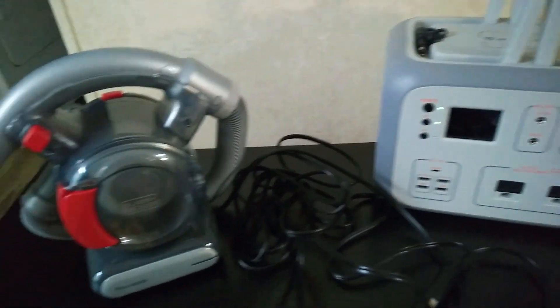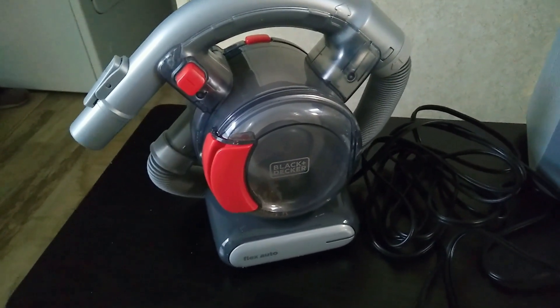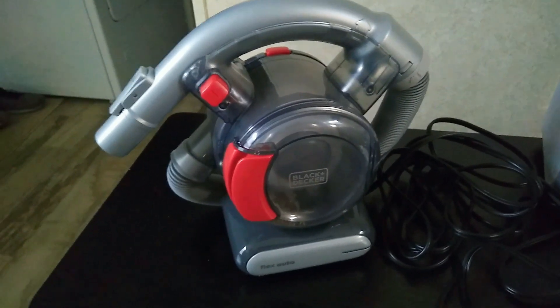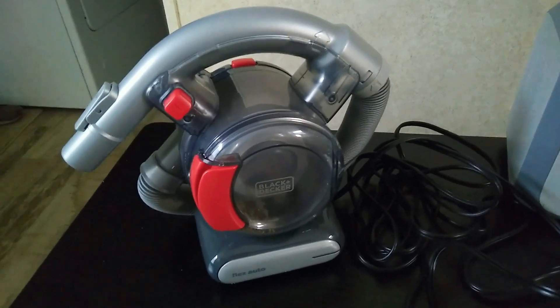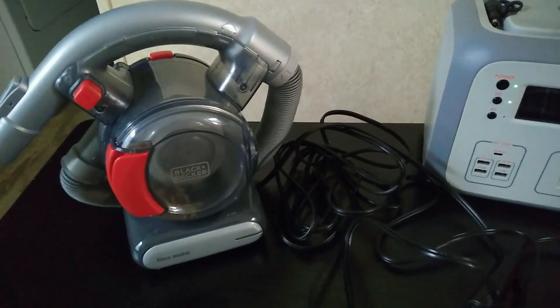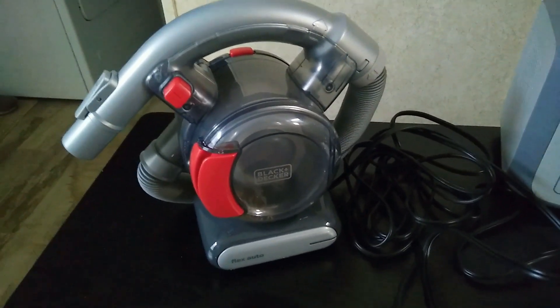Even in your car is that these things run off your car's battery. You can start the car and it'll run off the battery, but the battery is being charged by the car and the voltage will actually go up. With a unit like this that has a motor in it, the manual actually recommends not to run the car because the voltage could be too high — it's a 12-volt motor and when your car is running it's probably going to be around 14 to 14.5 volts.